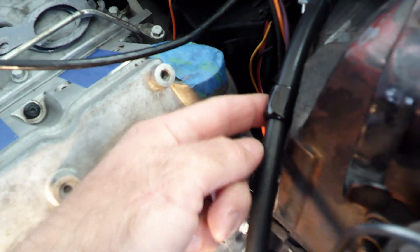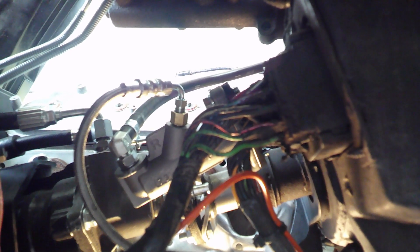It's the next day and I've pretty much wrapped up the clutch master cylinder. I finished the installation last night and today I plumbed the hoses. I routed the hose straight down through there, put a little hose clamp on it, just drilled a hole through the firewall, and it runs down and connects down here. You can see at the top of that brass fitting, the braided line that comes from the slave cylinder attaches right there, and it has some movement so that when I put the heat shield back on I should be able to tuck it up behind there. So that's it for the slave cylinder.